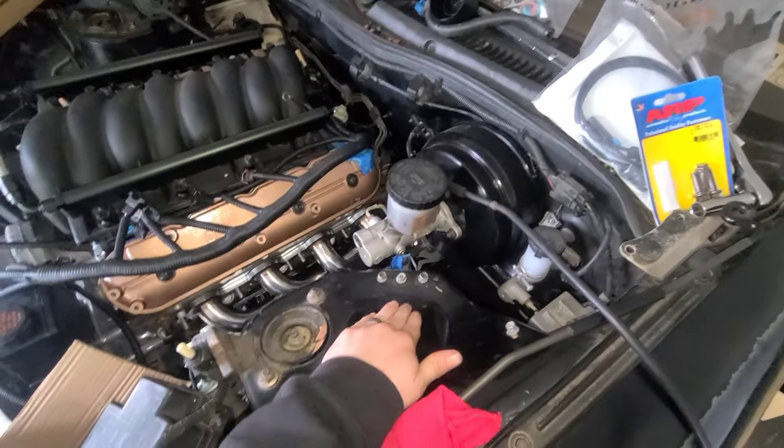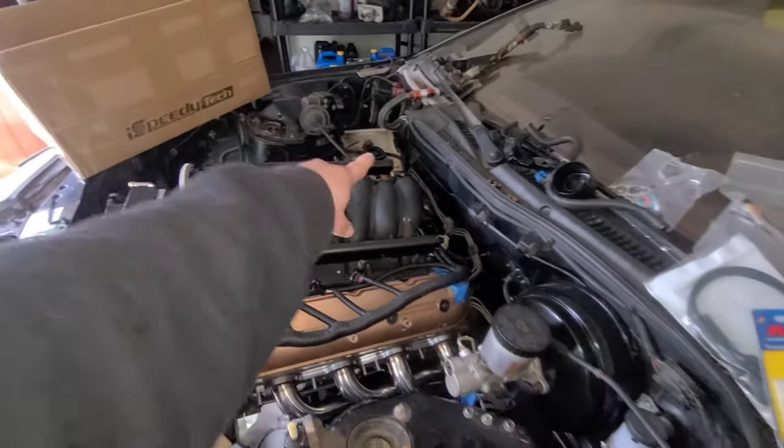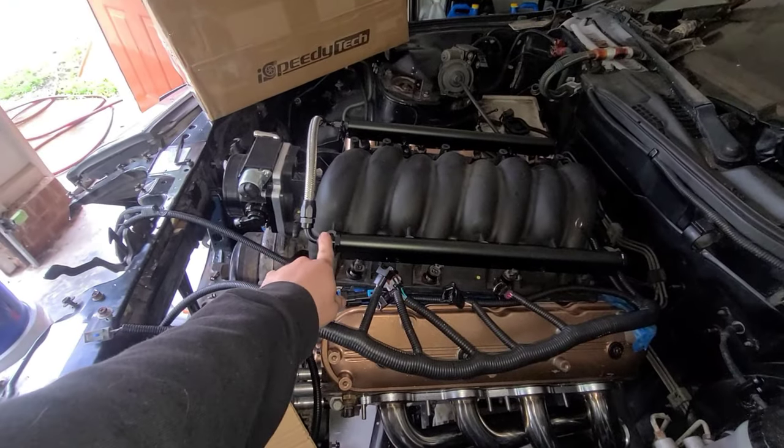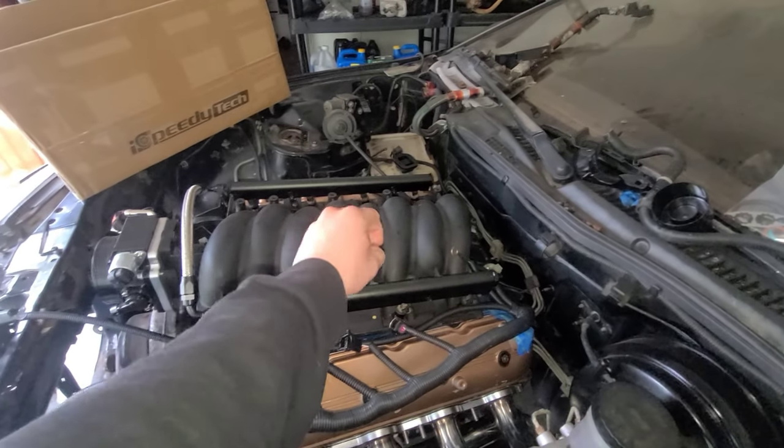Next — and that'll be on the next episode — we will mount the fuel sender unit and route it into the AN fitting for the fuel. I haven't decided whether to mount it in one location or another because of how the fuel distributes. The OEM one has a split port that fans out on both sides, so we'll figure that out. That's it for now — that's how you install an aftermarket fuel pump on the 300ZX as part of the LS build. Thanks for tuning in — if you liked what you saw, comment, like, subscribe, and thanks for watching.